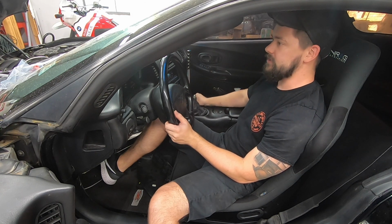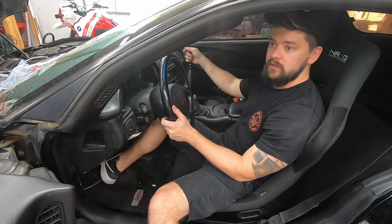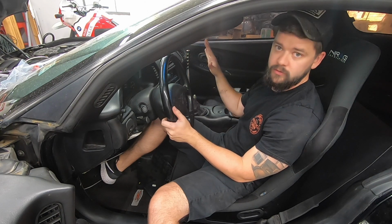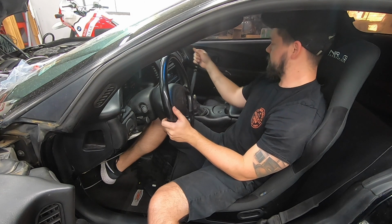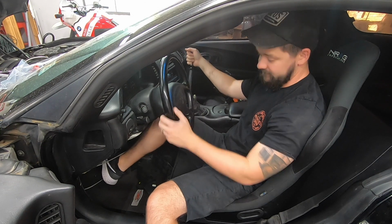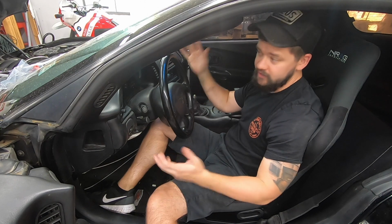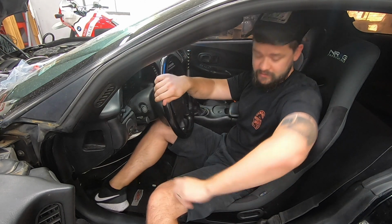I think we can kind of fine tune that because I want basically as little movement as possible to get it to lock, but obviously with no residual pressure when it's released. That feels really good. I think we may have nailed the bleed on the first try. That Motive bleeder, again, this is not at all sponsored or anything, absolutely worth its weight in gold.